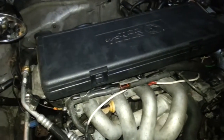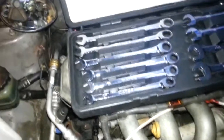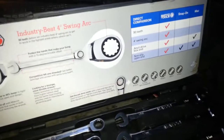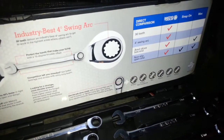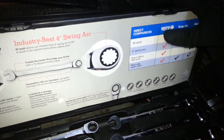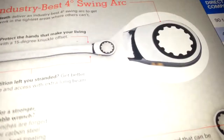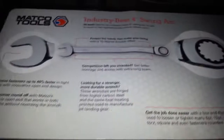Don't break things. I had some exciting things to share. I certainly could use my serpentine tool to do the job, but I'm kind of excited about this purchase, except for how much it cost me - like $400 for the Matco. It's supposed to be better than their lower-end ones. It's got 90 teeth instead of 72, and hearing 3 or 4 clicks instead of 1 or 2 is in effect what it feels like. They all say 4-degree swing or 5 or 6-degree swing, but have you noticed you have to swing it a lot more degrees than that to get it to click? My buddy at work picked up a few of these sockets designed like that, and they do work on more rounded-off bolts - probably not 50% rounded off like they claim, but it does really help.